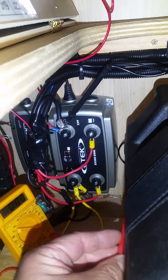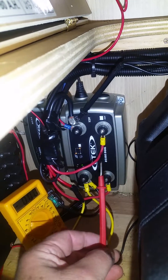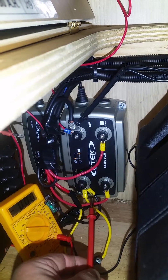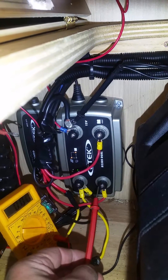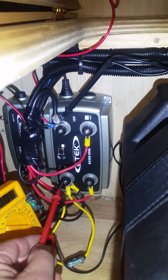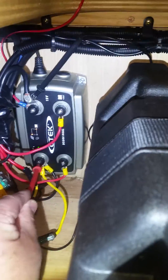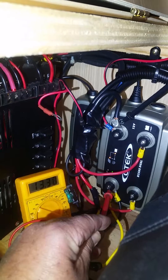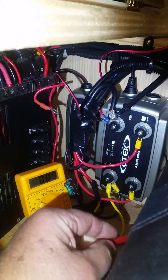Hi, and thanks for your help with this problem. This is my connection to the service battery. This is my solar input — I have two connections to an Anderson plug on the frame of my caravan, and this one goes to the panels on the roof. This is the connection to my alternator, which is not connected at the moment. I'm getting about 13 to 13.5 volts through the solar panel right now.